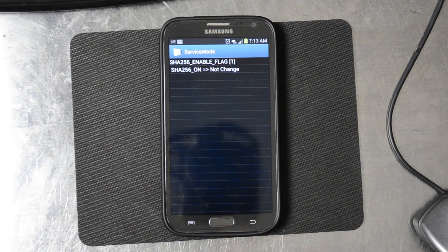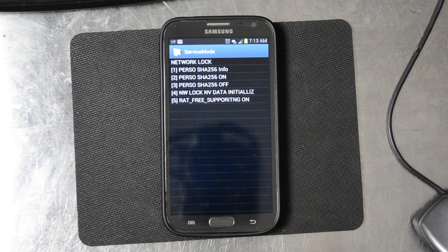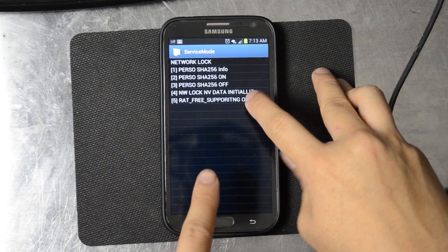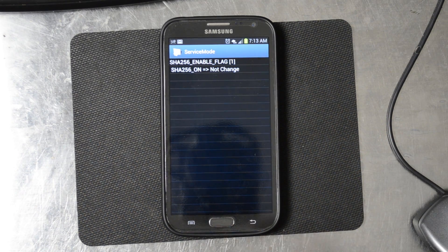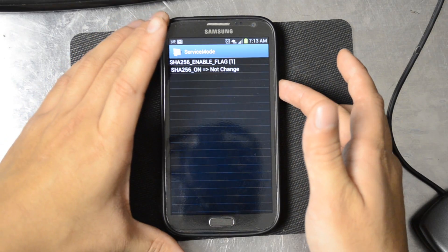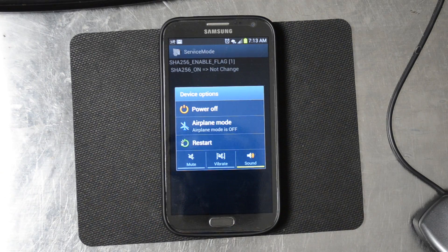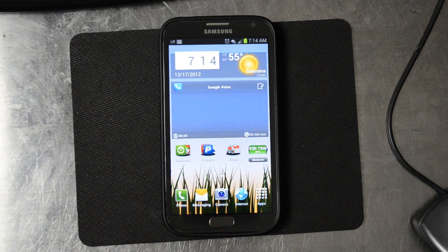Start a timer. Wait 30 seconds and after that 30 seconds is complete, quickly go back. This is what most people said works — then go to number four, NW lock NV data initialization, and remain there for a minute. After that go ahead and reboot your device, and after that it should allow the foreign SIM card and shouldn't give you a warning about needing an unlock code or anything.